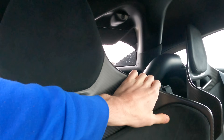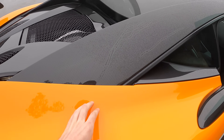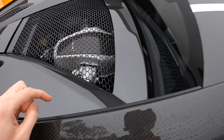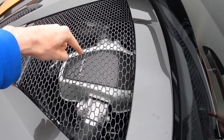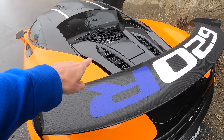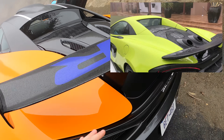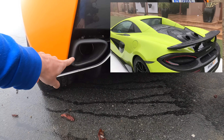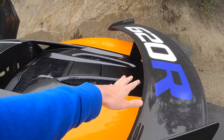This is a V8 engine, and it passes that air back down through here into the airboxes before moving over — you can see the throttle for each individual side, your intake manifold, before it passes into the engine. After traveling through the engine, unlike the 600LT which had a top exit exhaust, here the exhaust comes down and exits out the back, so you don't have that exhaust interfering at all with this wing back here.